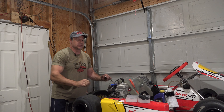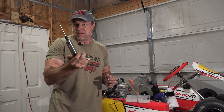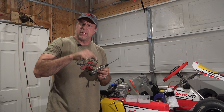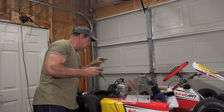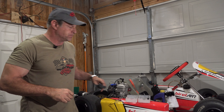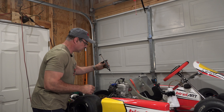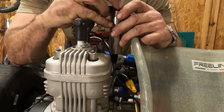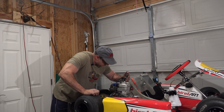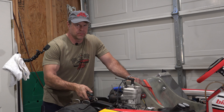So what's the solution? Williams Sonoma or a good kitchen store — this is a meat tenderizer injector, and it even has cc markings. You put 40cc's of oil into this and inject it slowly down the hole, because if you do it quick it's going to come right back out at you. That's silliness number two. I've got 40cc's — about 1.35 fluid ounces — and I'm slowly going to put that through the fill tube. Wish me luck; it just takes patience. We're just finishing up — it's almost full, it took about five minutes to slowly get it down that hole. Chain guard's back on, struts back on, airbox back on.